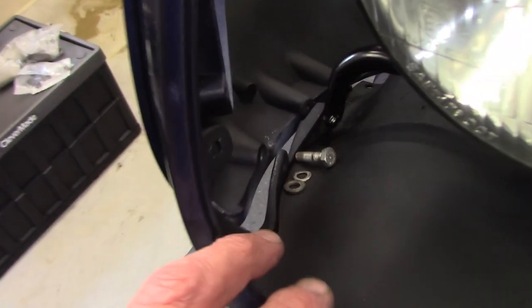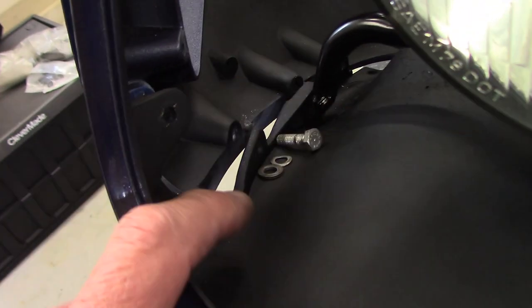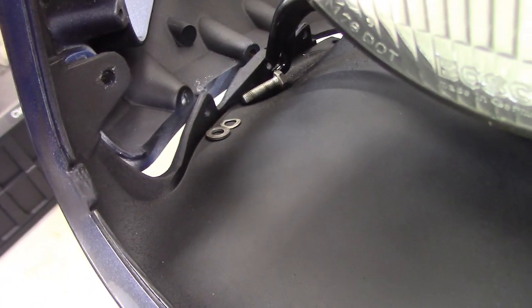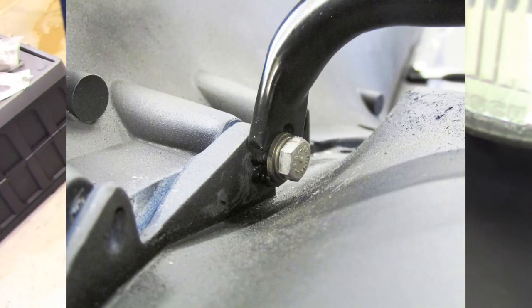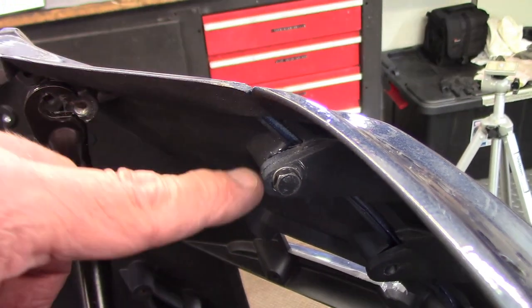This is the headlight panel. On the inside, this is the lower arm of the fairing bracket. This is a 22mm long M6 bolt with a thick washer and a wave washer — it's going to run through the bracket, through the panel for the headlight shell, and then into a bushed hole in the upper side panel. That anchors the bottom of the upper side panel and the bottom of the headlight panel together.